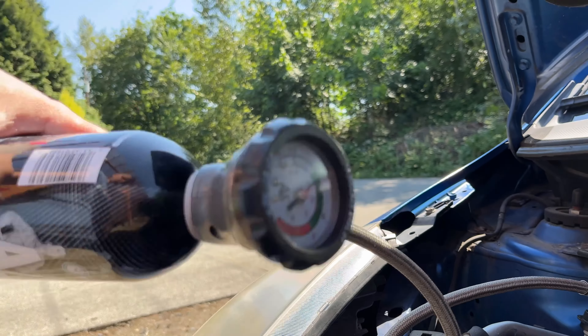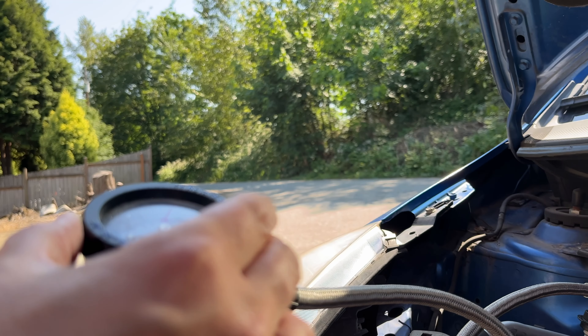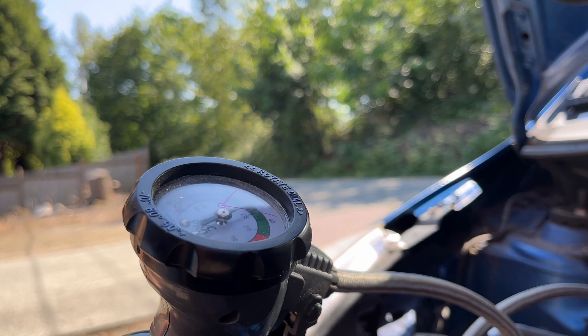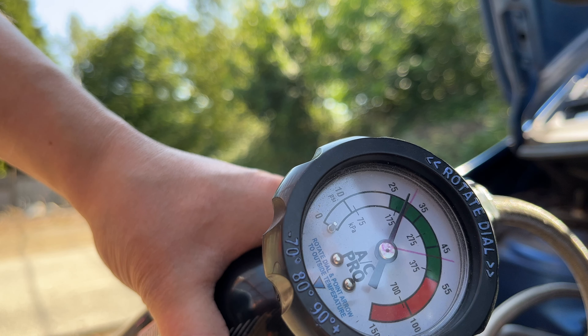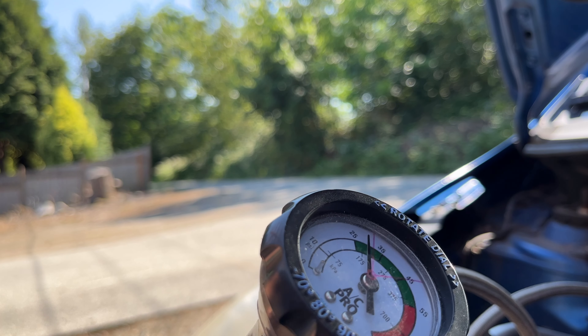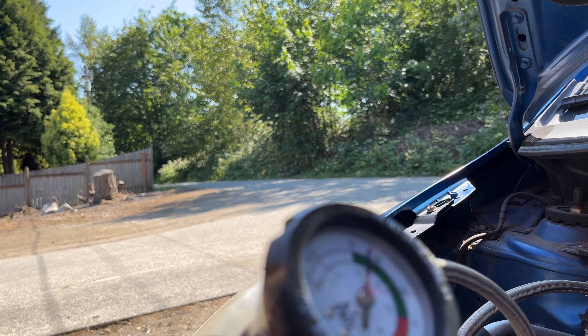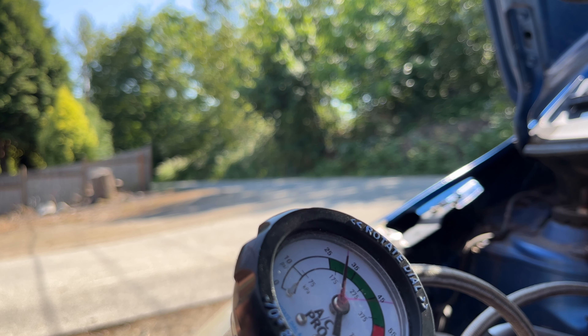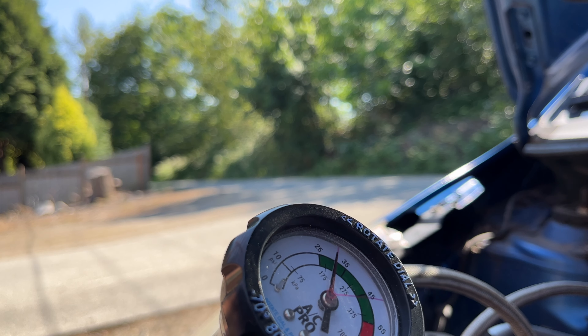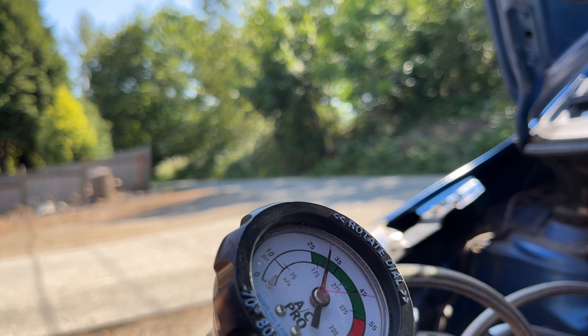This gauge has an ambient temperature gauge as well — I apologize, it's really blurry here, I'll give you a better shot in just a minute. With this particular gauge, it says 70, 80, 90 degrees at the bottom for what the air temperature is outside. I've set that dial and now I'm looking to get my refrigerant in between the red V that looks kind of like a pie slice on that screen. My daughter's when I first started was below 25, at the edge of the white. I've already squeezed the trigger a couple of times, and tipping it upside down one or two more times it stays right there on the edge to the left of the pie zone.